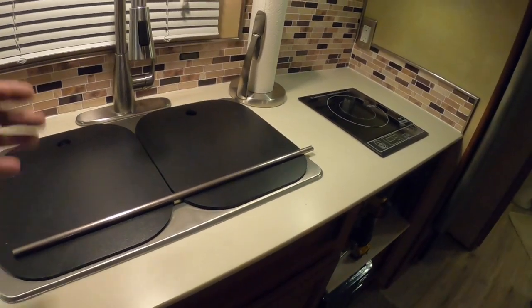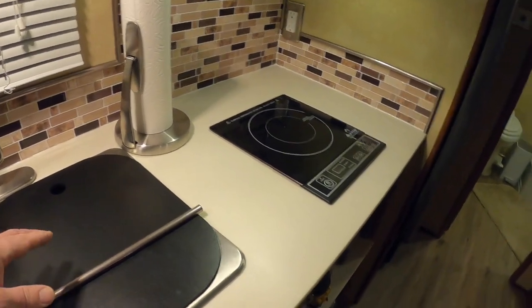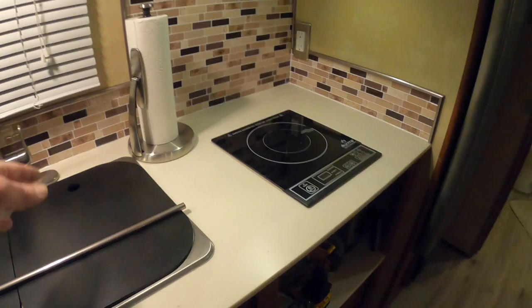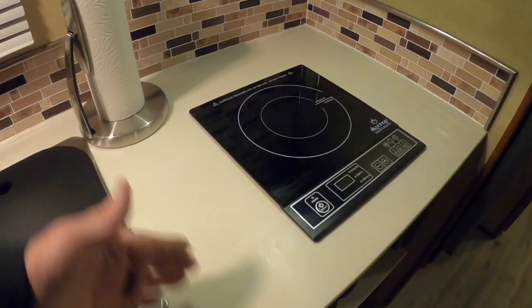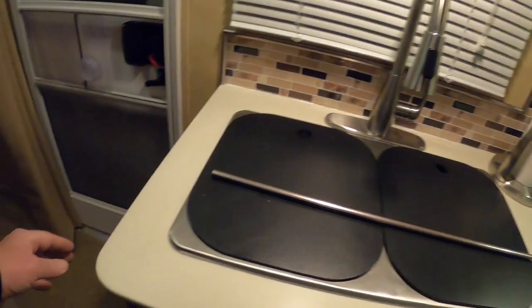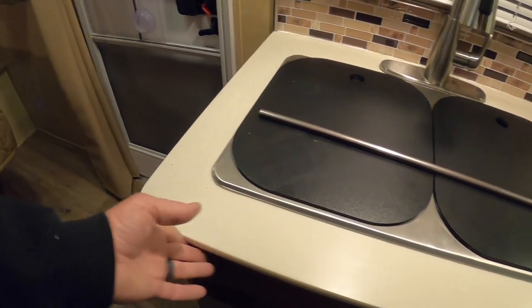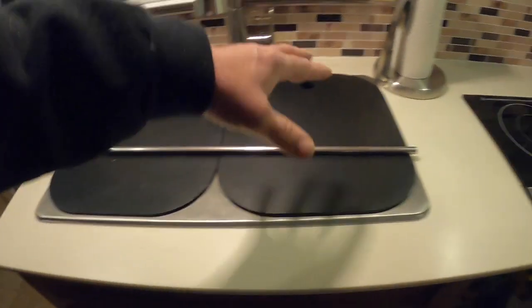I got this from Fabrication LLC. If you're in Denver, talk to Tyler, ask for Tyler, and he'll hook you up. But I just got rough cut Corian to the size I needed, and the edges were real nice already. Here I had to put the curve on with a jigsaw, as you saw in the video, and then just route it, cut your holes, and you're good to go.